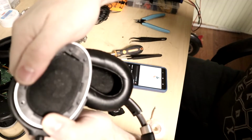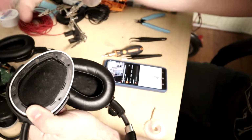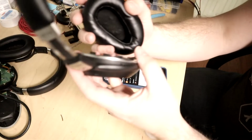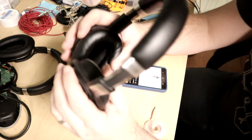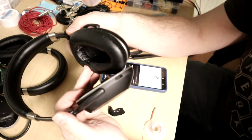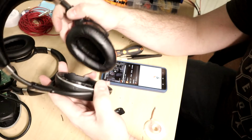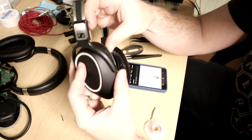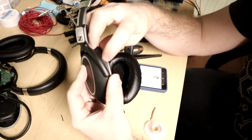Yeah, so I didn't have it pushed down enough, and I think just when I put screws in there, it's going to be fine. So it was just those push pins. So what I can say is we seem to have fixed this one set of headphones. That is fantastic. Very easy fix. Just replace the Bluetooth switch to now be, instead of a Bluetooth switch, the on-off switch for the unit.